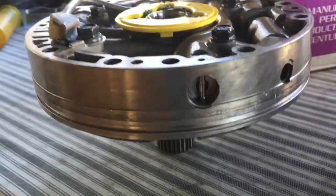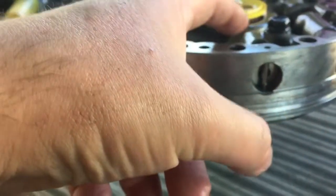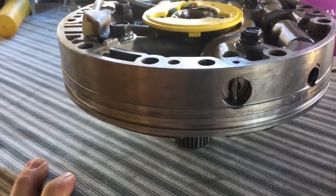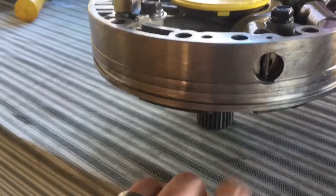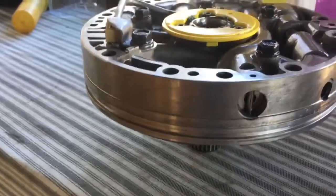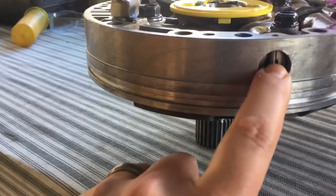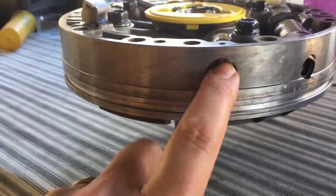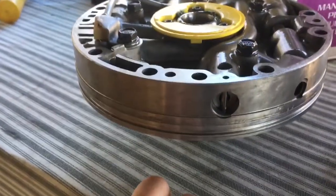In higher pressure systems, there's a nail — a retaining pin — that goes through the pump body to hold that spring in place and prevent it from pushing out, keeping tension on a ball that relieves pressure when needed. The issue is that over time it fatigues the spring coils, breaks the bottom coil, drops tension, and causes the valve to buzz. One of the guys had a simple fix: take a small stainless steel washer and get it in between the retaining pin and the spring. We did that — it's in there now, though it's definitely not something you could do once the transmission is in the car.